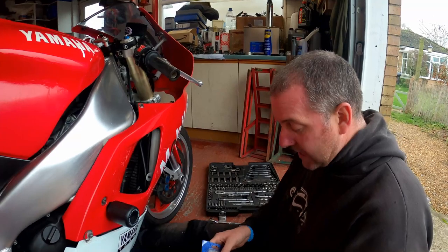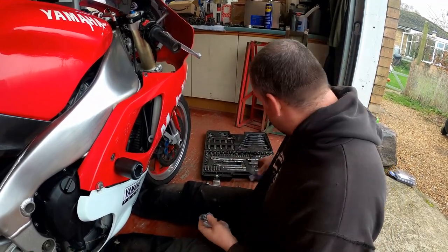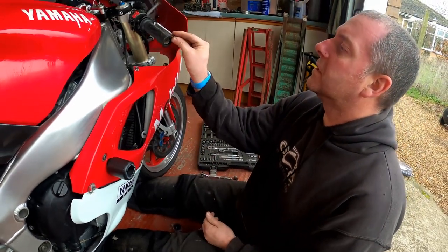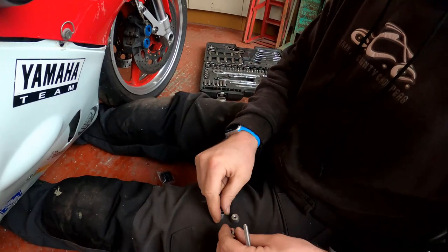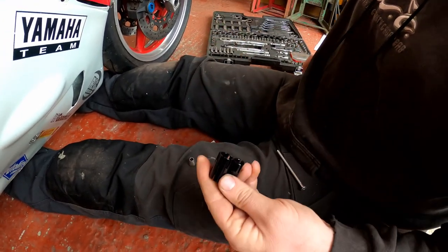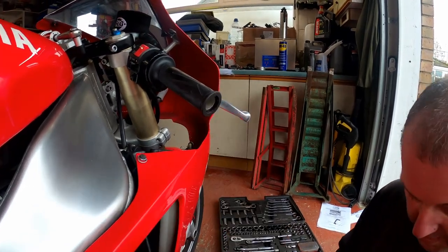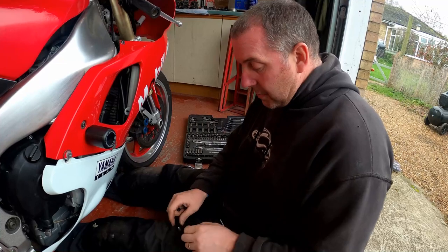So what I need to do is open up the little hardware package. Oh look — more R&G stickers! The day just gets better — that's four. Okay, hardware then. Let's pop it open and have a look. So here's the bolt — the long one — showing you how far in it's going to go if necessary. You have different sizes of fitting hardware, and we've got a little package here with an expanding collar. The expanding collar obviously needs to be the right size to fit inside the handlebar. That one won't go in any further than that, so that isn't the one we want to employ — we want to use the smaller one. These two larger collars are for larger diameter handlebars, so they're redundant. We want to use the two smaller parts.